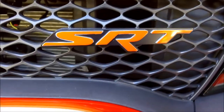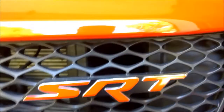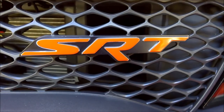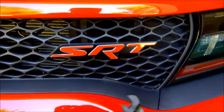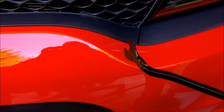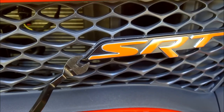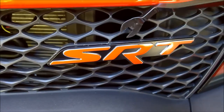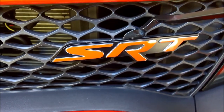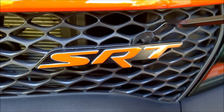I'll end up with basically the cat head badge at the end. I've already pried the badge off the car and was able to do that without breaking the two tabs that actually hold it on. However, there were some alignment tabs that did break. The tool I used was just a regular upholstery tool for pop pins. I started under the corner, worked the clip loose, then worked down from the top, being very careful not to hit the lip of the bumper.